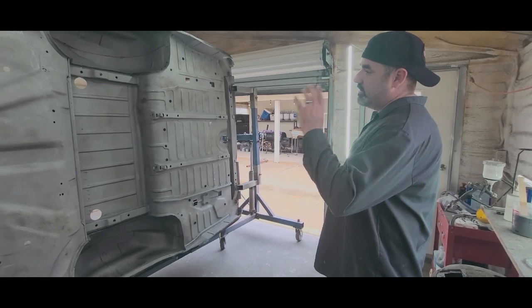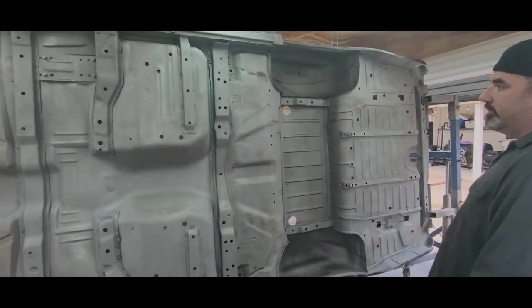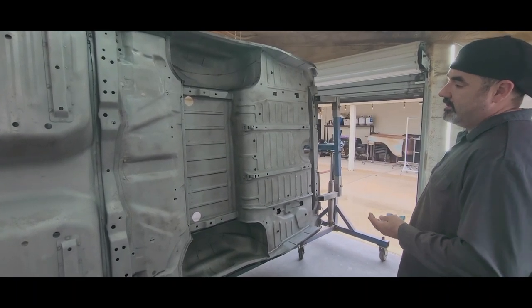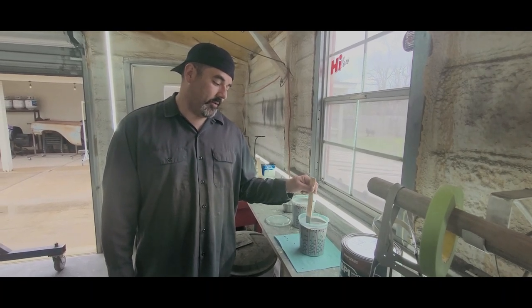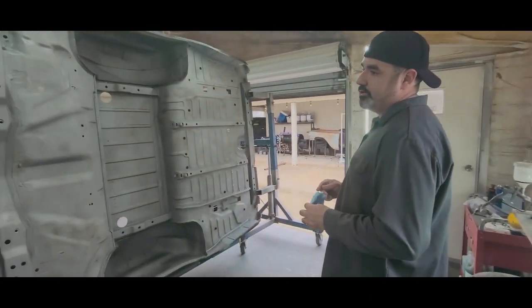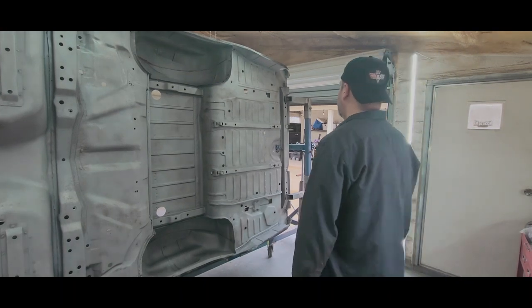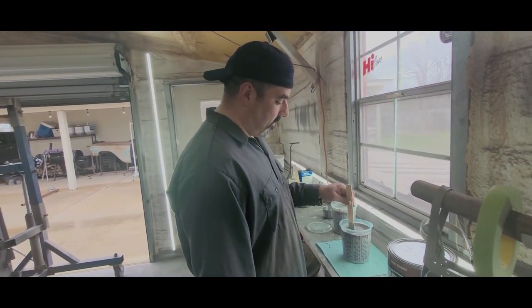Sprayable glue is going to stick to this since it's porous because it was blasted. It's going to stick to it, and it's going to form a waterproof bond, basically. Not water resistant, but waterproof. Waterproof, oil proof, brake fluid proof. This stuff is bulletproof. Basically, that's what we're here for: corrosion resistance. You definitely don't want to spray a 2K primer on this because that's porous, and over time the moisture is going to get through it and it's going to flash rust bad, or worse than it is. But like I say, it's still going to last a very long time. But with this SPI epoxy, it's truly bulletproof. So, enough yakking. Set you guys up on tripod and we'll get spraying.